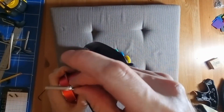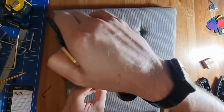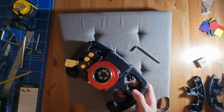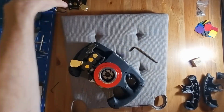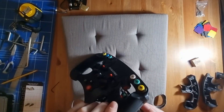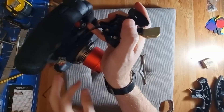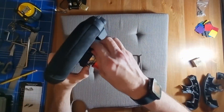We have to carefully tease the wires out. The strong magnets mean the screws end up sticking to the shifter, but you can remove those afterwards — just be a little bit more careful when putting it back on. I had a little bit of difficulty getting the wire out and used an Allen key to just hook the wire out of the way.